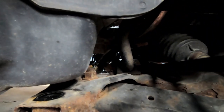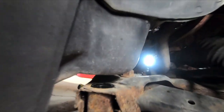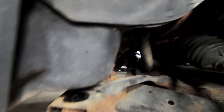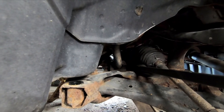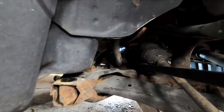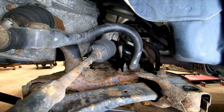We're loose, so let me go do the other side — there were only those two bolts in the rack. Lower your jack — wait, stop! I just realized I forgot the hoses. There's a bracket with a 10-millimeter for the power steering hoses still mounted to the cradle. I'm going to run the two back bolts back in and tighten it up so Alex can move his jack, and then I'll remove that bracket.